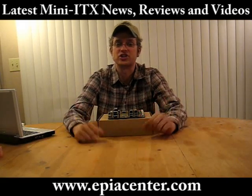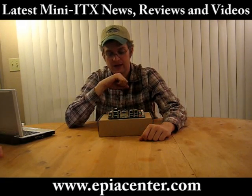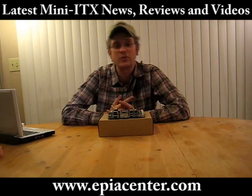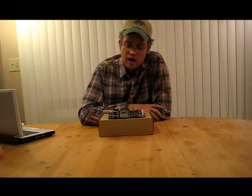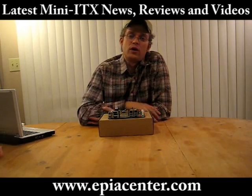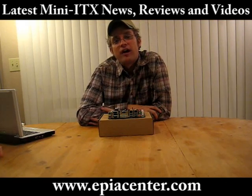What's really interesting about this mainboard is the 690G chipset with an integrated Radeon Express 1250 with four active pipelines — pretty much the best onboard graphics you can get for the money — because it supports HDTV resolutions up to 1080i, and with an additional component interface you can even play back HDTV resolutions up to 1080p. Let's see how this combination of the 690G together with an Athlon 64 Dual-Core processor is going to perform for multimedia file playback.